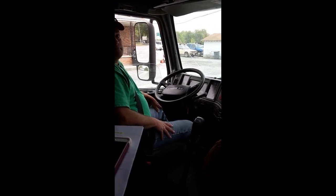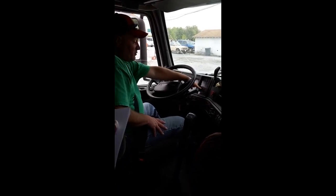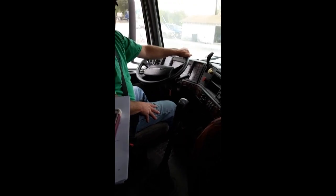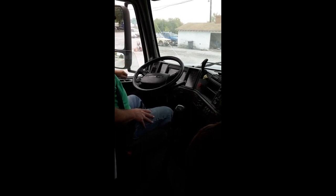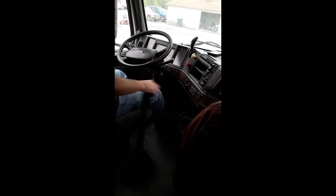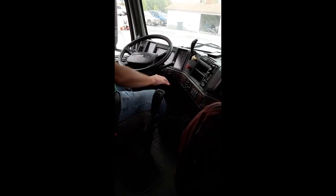Now, second step. Fan the brake down, 60 PSI, the buzzer should come on. Approximately 60. Like this one, it actually comes on about 80, 85. Yeah. All right, there's 60. We've got both my warning lights, and I'll ask you to tell me when your lights come on. Last step. Fan them down to 20 to 45, so then we'll pop out. Yep. It's over. That part is over. Now I'm going to build the pressure, and I'm going to show you how you will actually do it in real time and how fast it goes.